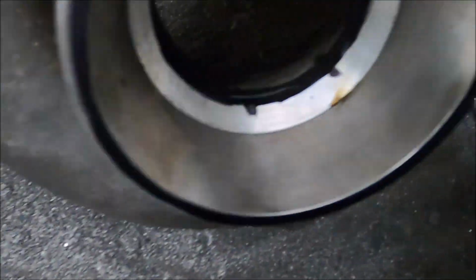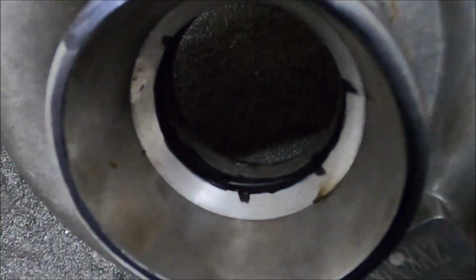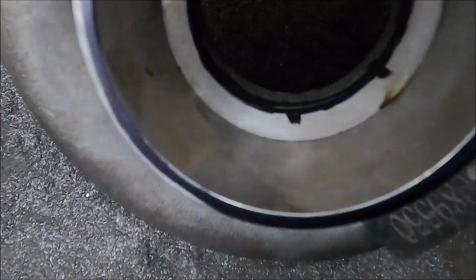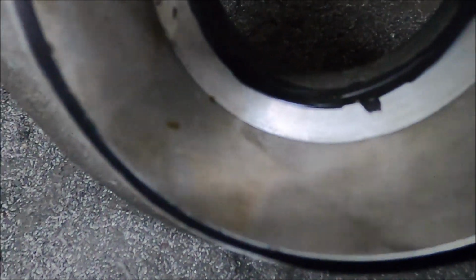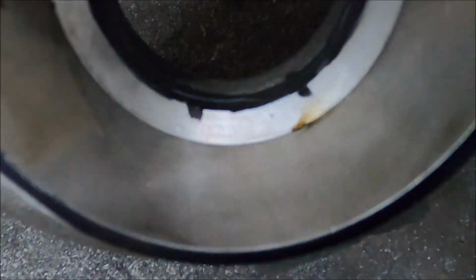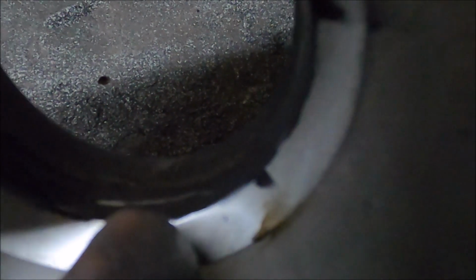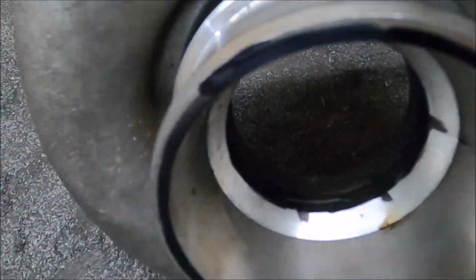And the other thing I'm going to do is sit it in with the compressor wheel in there, so I know where it sits, and I marked where the edge of the blades ended, and everywhere I've drawn in black can be removed basically. So what I'm going to do is make that taper more gradual, so rather than tapering to there and then flat in, it's going to taper all the way from the edge of the black.